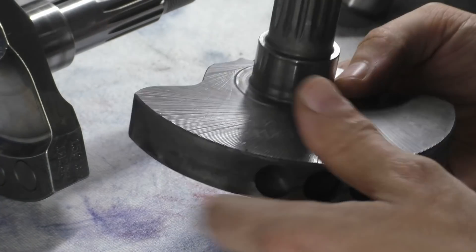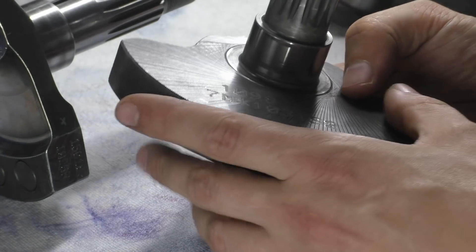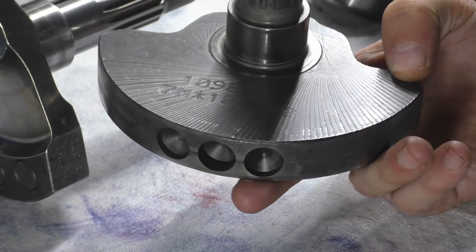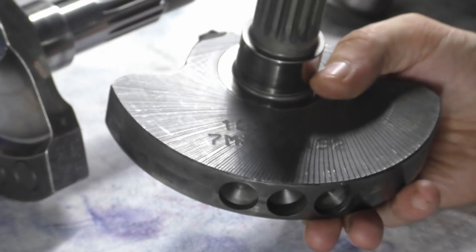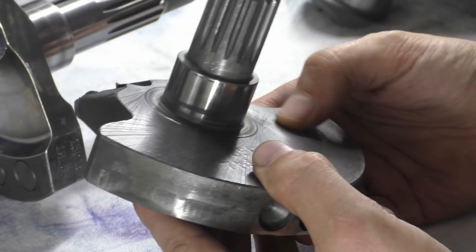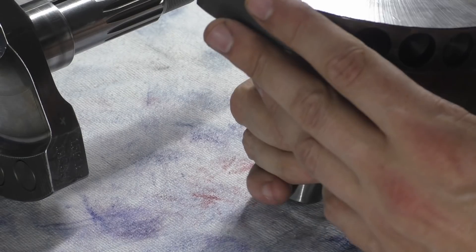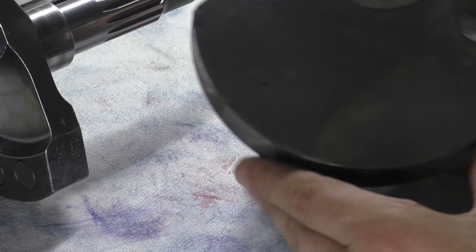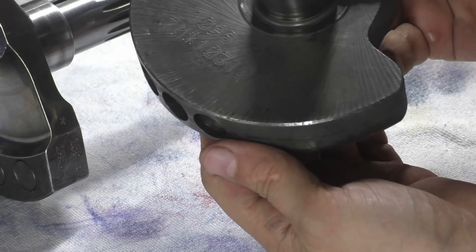My god, that's rough — that's the point I was making. They can't have surely done that on purpose. These striations where these tools have cut — this is just rough as hell. The tool tips, the inserts need changing because you can physically see it's like a shell. I was looking at it going: what has done that? Is this like a rough cutter? It just looks like it's cut away with little jaggy marks, like the tool's on its last legs. The other tool on the other side — because basically they run wheels down either side — this one, if you look at it, isn't as bad. That cut there just isn't as bad a texture as the other.